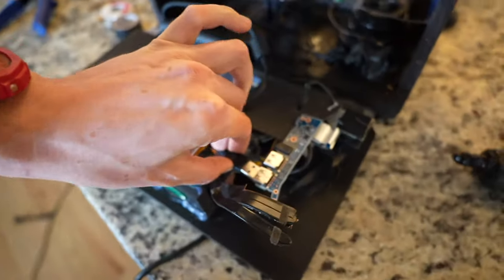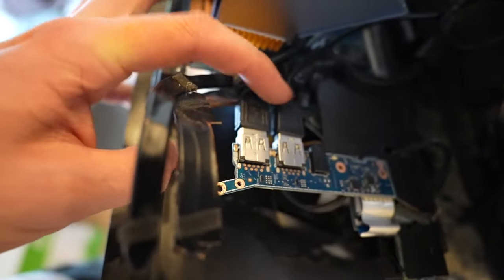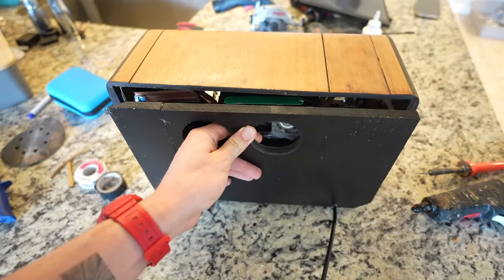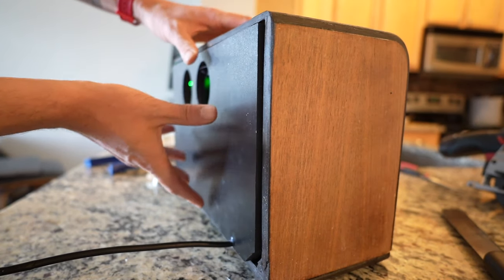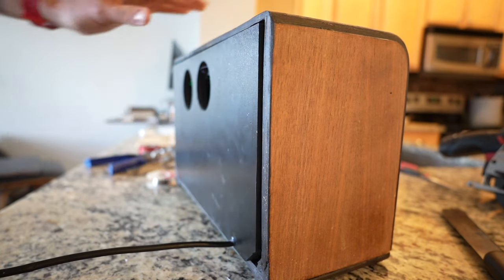The USB for the Teensy LC microcontroller as well as the front fan and the plasma globe plug into the left side daughter board of the laptop. So I'm losing two USB ports, but those ports will all be internal — and you know that a small form factor build has been done successfully when the back panel goes on just like this.